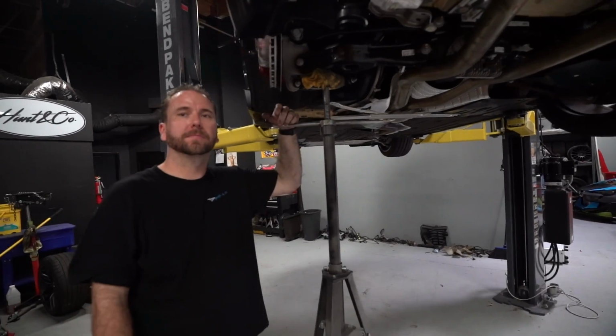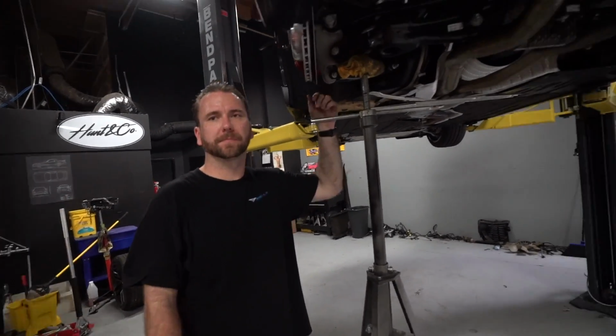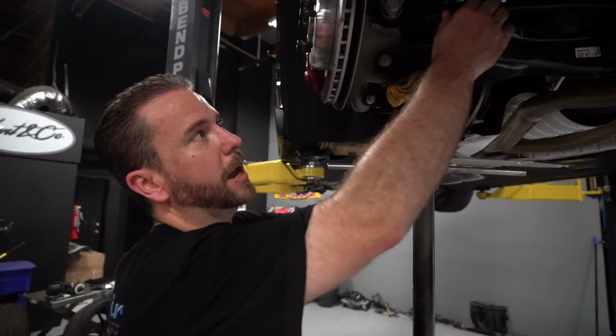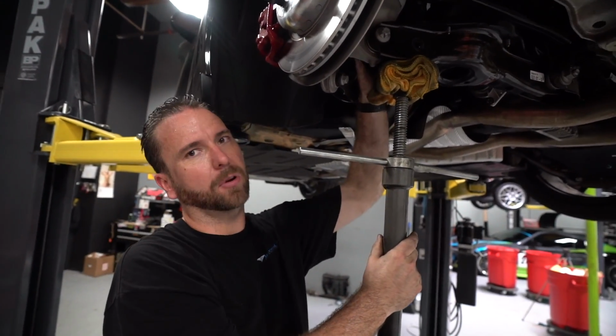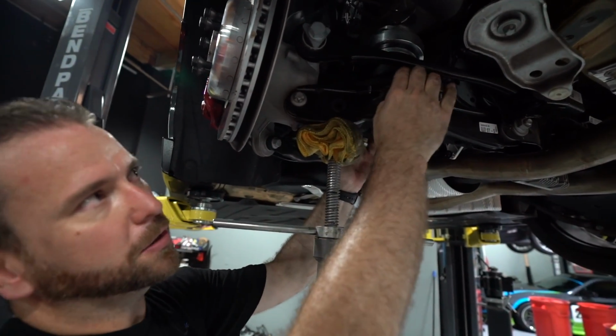Diving into today, before we get into the discussion that we had earlier about retaining the stock struts versus replacing them completely, right now you're taking measurements for designing and creating the airbag system for the car, is that right? Correct, yeah. I'm trying to make the mounts to locate this bag in here, so that it'll clear this arm, clear these massive axles that are in here, and the shock absorber.